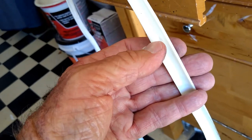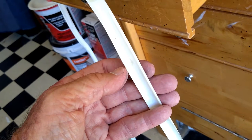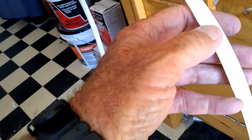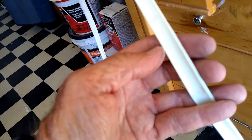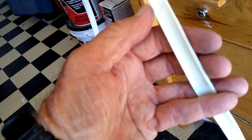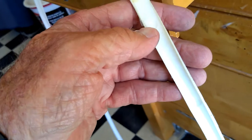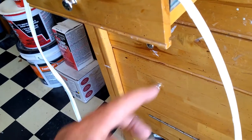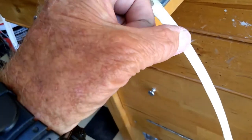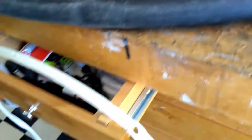This right here — you can see that the dent which is supposed to cover up the hole is not actually covering up the entire hole. Every other one of these things — this one in particular — it's terrible. Look at that hole, look at that dent right there. The edge of that hole is not covered by the tape. Because there were so many of these where the hole is not covered by the tape, any one of them could have been causing the tiny little cut. The flashing would be right about in here, and when the tube is blown up and expanded, it'll catch the bottom edge — and that's where all the little cuts were.